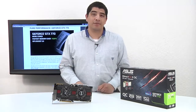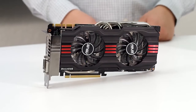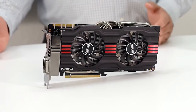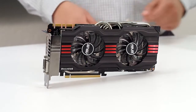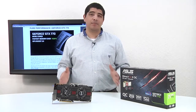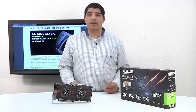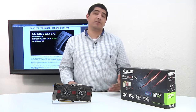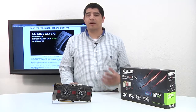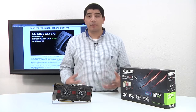Now that we've covered the accessories, let's talk a bit more about the actual GTX 770 in itself. So this is a refresh that actually replaces the previous generation GTX 670, which was a high-end GPU that was really focused at ultra-high 1080p-based gaming, and even to a degree ultra-resolutions in terms of 2K resolutions like 2560x1440 or 2560x1600, or 3D or even multi-panel configurations. So this GPU definitely is once again within that same ballpark, but even further improved upon in terms of the performance. The actual core itself is still based off the GK104, but one of the significant points of improvement is a significant increase in the number of CUDA cores — essentially the horsepower for the graphics card. The more cores we have, the more capability the card has to process through and provide the best level of image quality at the highest resolutions.